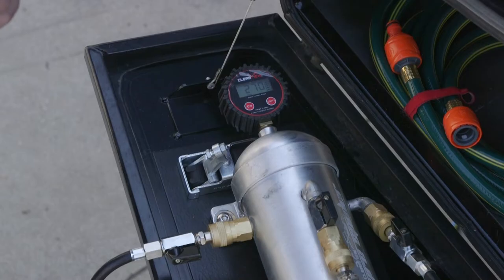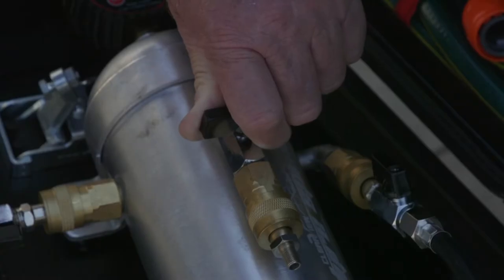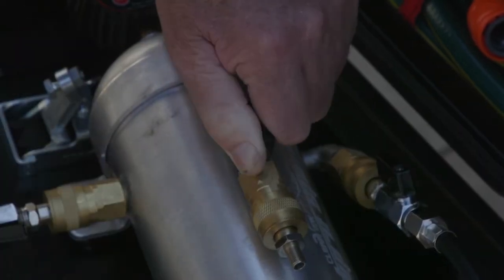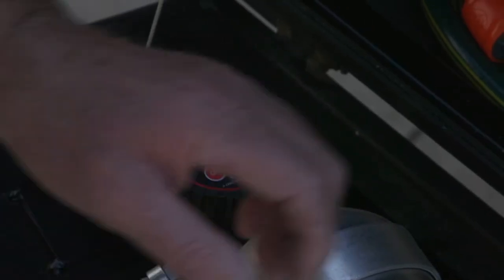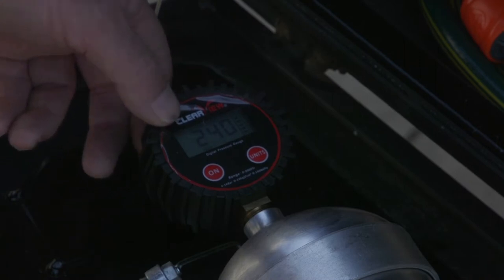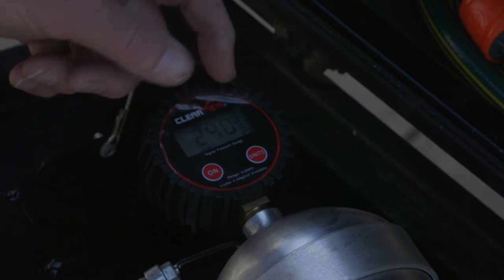You can see that there's about 27 psi around. We want to deflate, so we're going to deflate our tyres down to 18 and 22. Simply turn this on — what's happening is all that air is now coming into one chamber and we're deflating. Once you close this valve off, it will give you a pressure. In that short stint we just did, we've gone from 27 to 24.